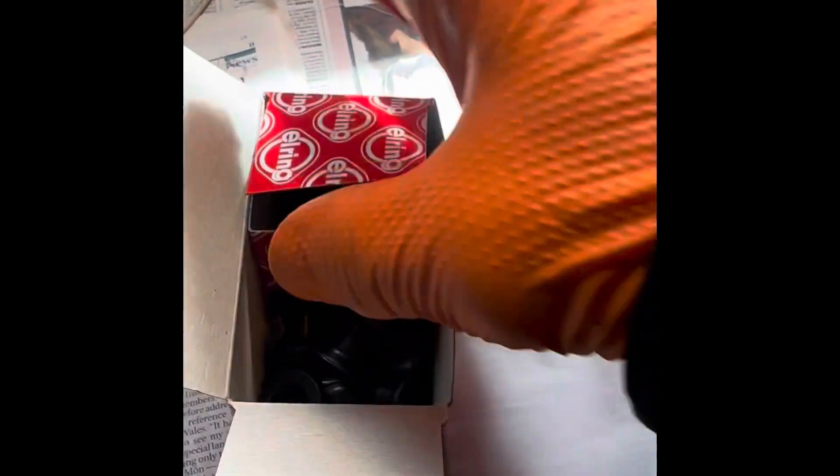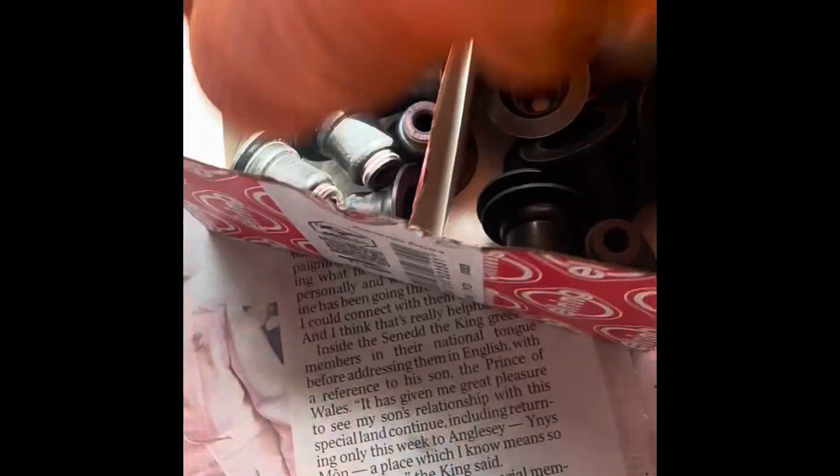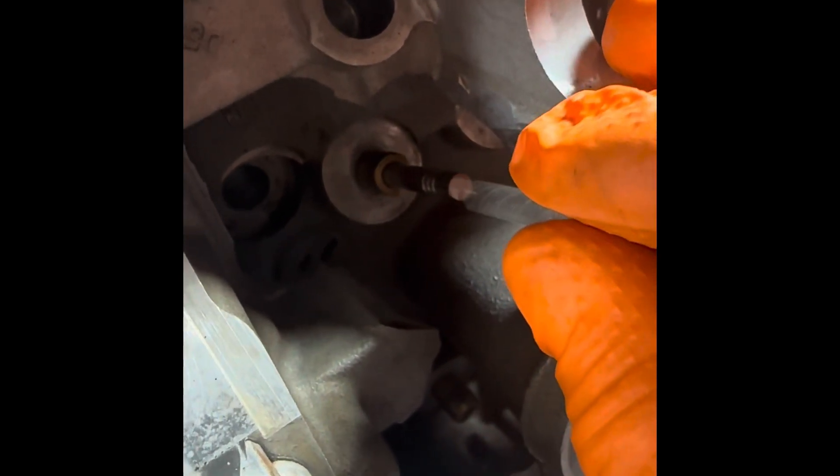Look at that - don't you love that sight. Now I'm servicing this and doing the refresh. There are a load of videos on this for the refresh for this mini, but unfortunately for me I found out they've got new valve stem seals on it anyway. BMW had already put new ones on so someone has had their head off. And there's a very important plastic bit in here - this little plastic thing is the most important bit. It sits over the valve stem so the seal doesn't get caught on the ridges where the collets sit. So we put that on first and then we can put the stem seal on.